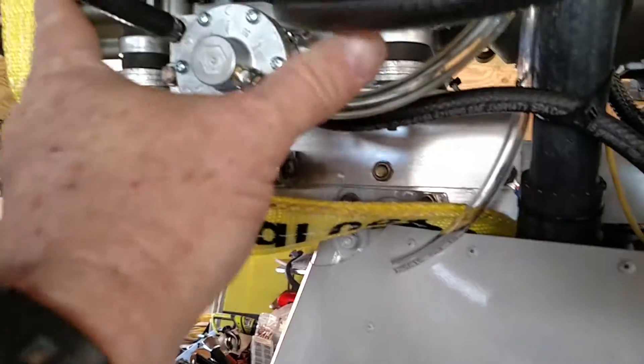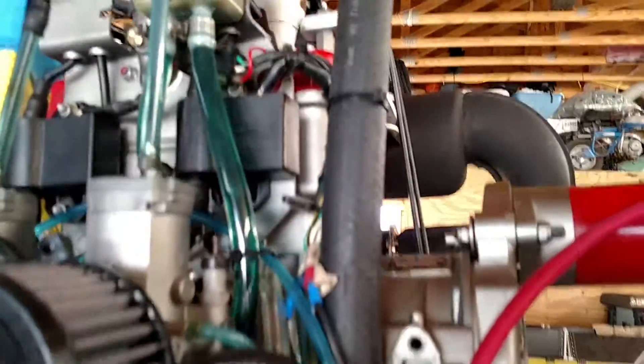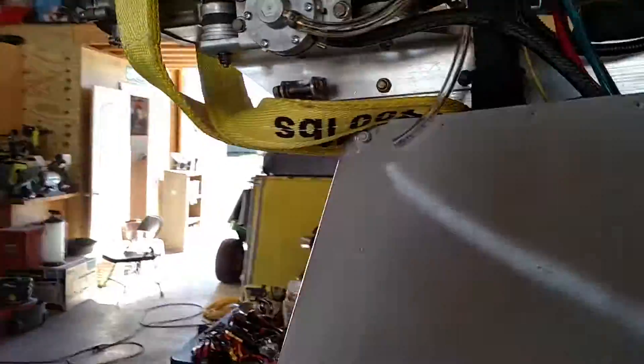From the electric fuel pump, it's going to go out and up to the pneumatic fuel pump, and then it's going to go through these two lines to the carburetors. All the wires are hooked up for the magnetos, for the kill switch, for the tach. Everything is working. I also have the starter solenoid mounted and wired and flyback diode installed.